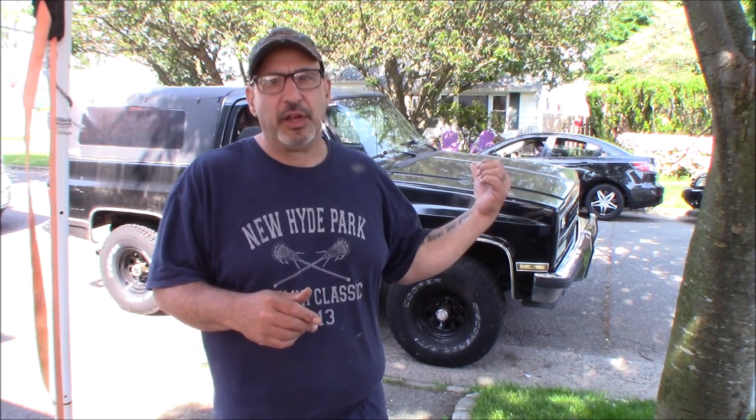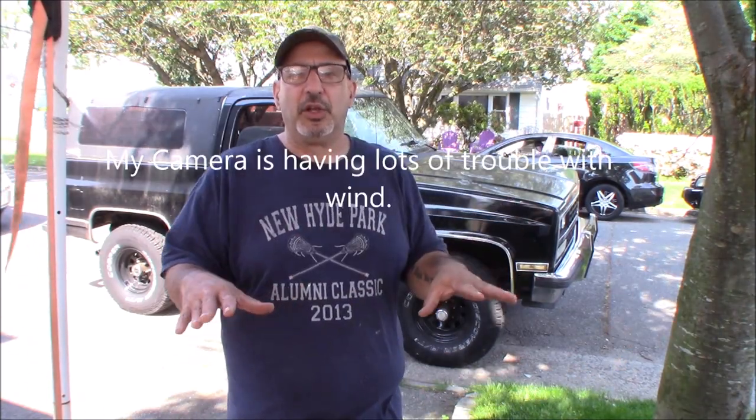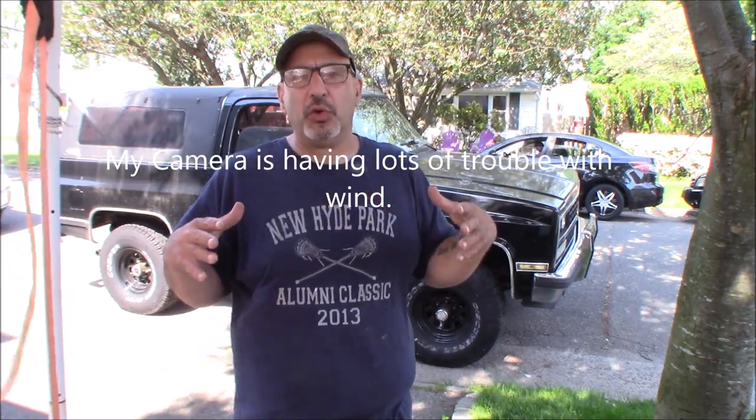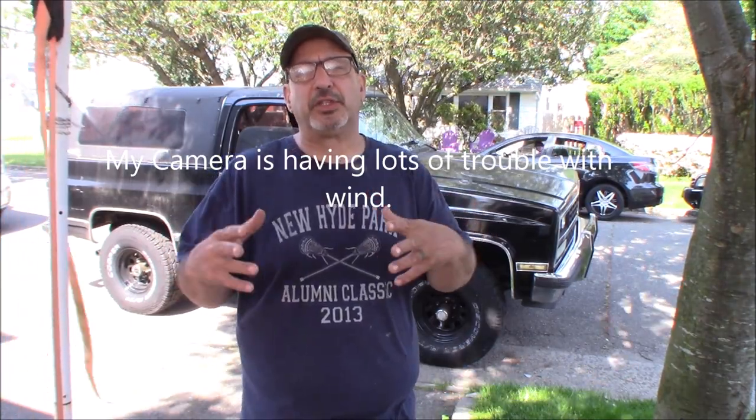While we're getting ready to do that, he started driving it when the weather broke, and he's got a little clanging going on, and I'm going to see if I can replicate the clang right here in front of the driveway. Sounds like a U-joint. We've never done the U-joints on this one, and if those of you that have been following along on this K5 project, every time we have a little issue with something, we just replace it. This was starting fresh, 30-something years old, unknown history on maintenance other than the replacement motor that was in it, a Jasper motor.